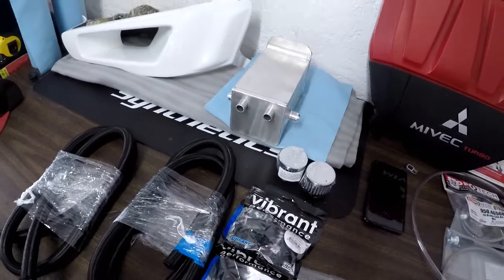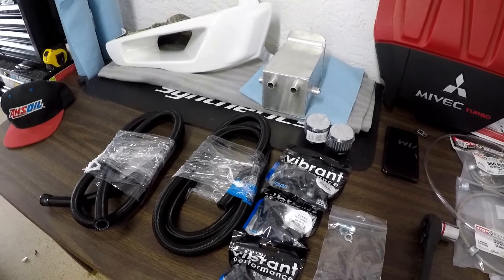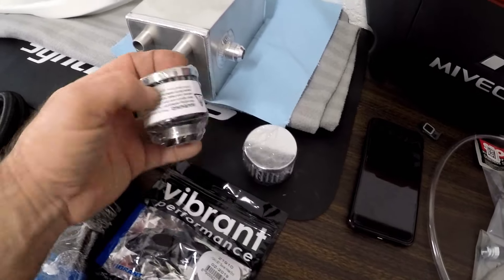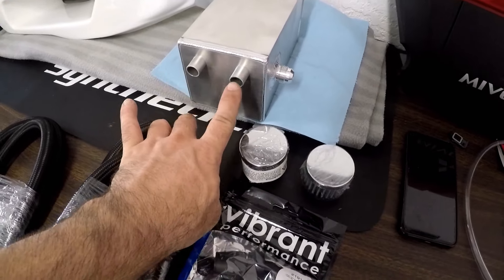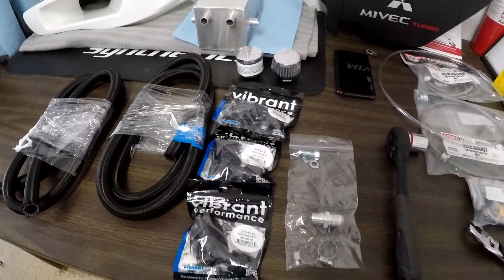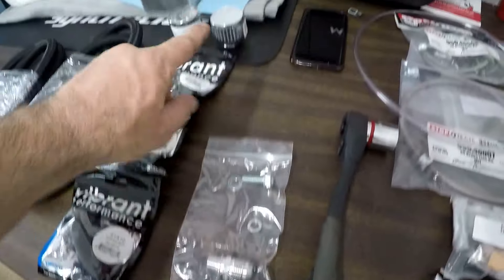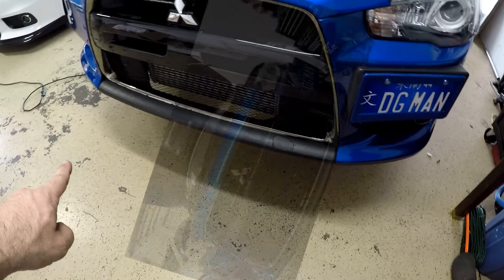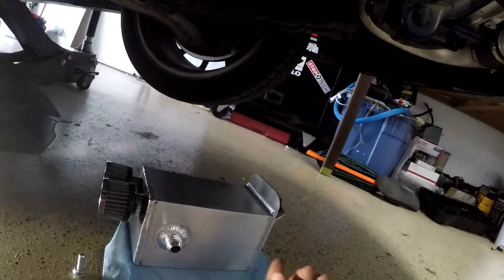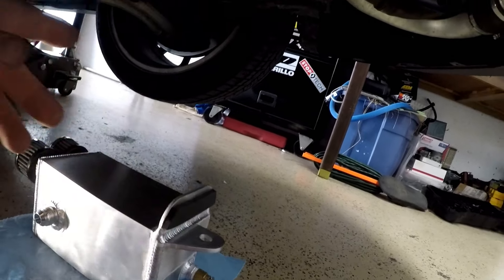Now that I've taken down the whole tray, I do suggest taking the whole thing down — if you don't, it's definitely a pain to get your arms in there, and this is a pretty big catch can. So we'll prep up here first. You have your two little provided filters with little clamps — put those right on the ends and clamp them down, don't go crazy on the clamping. Then grab your bolt, washer, and lock washer and we'll meet back down under the car.